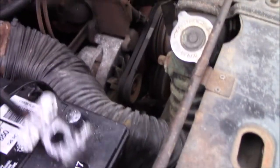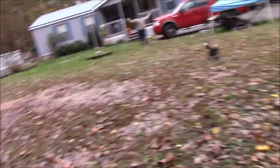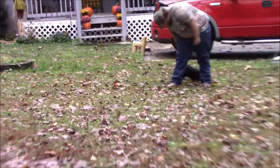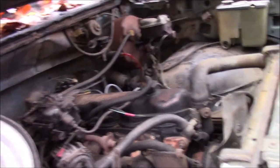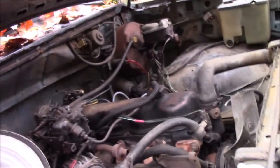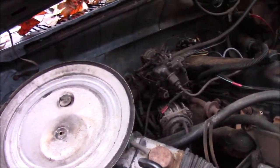Okay, well it stopped. Doesn't do that anymore. Your headlights are on - not 100% sure what that's about. Basically, whenever we were holding this battery terminal up and it was connected, key on, it would turn over like it should. But whenever you cut it off, it would continuously turn over. Something's getting stuck, is what I thought. So we bought a switch - well, not a new one, but from a junkyard - and replaced it.